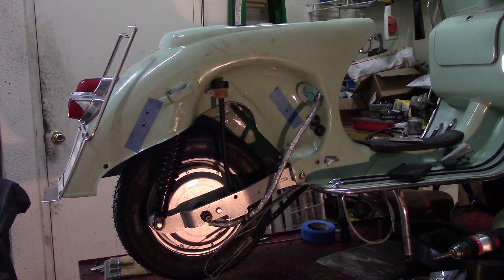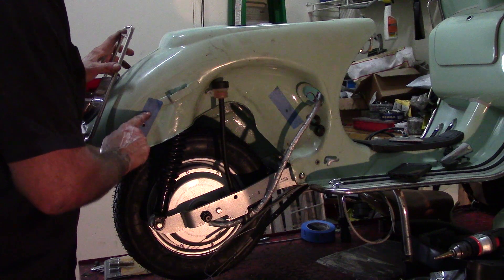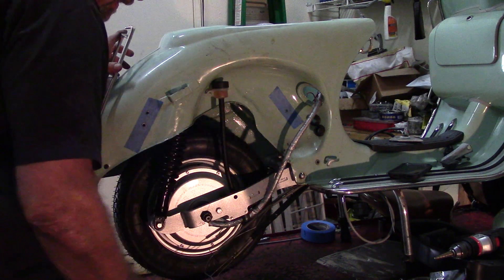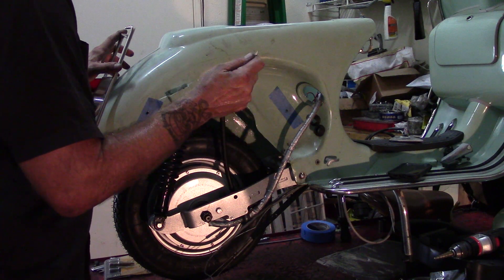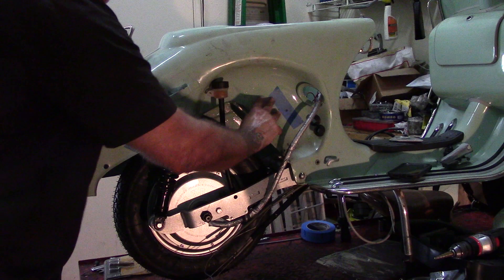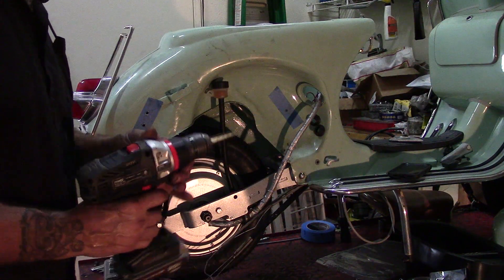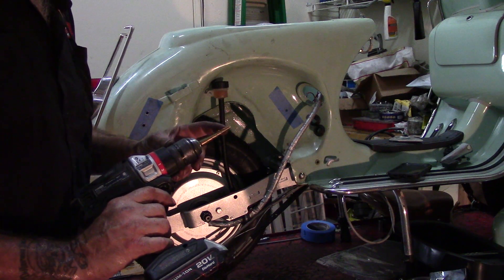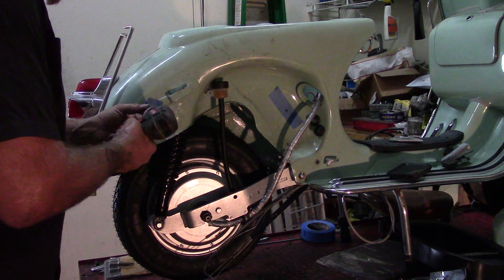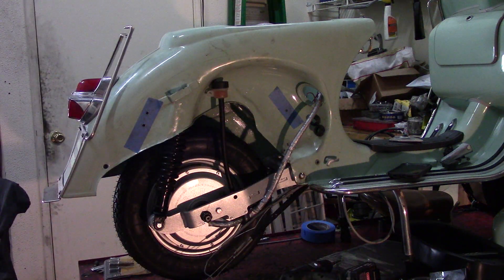It's always good practice when drilling into painted bodywork: you measure, line up the tray, mark where your holes are, take a punch and dimple the metal so the drill bit can bite it, then put a piece of masking tape on to protect everything from scratches. When doing bodywork, I use what's called a step drill bit. It required a six millimeter hole, which is the second step, so you just drill carefully until it's in. Then you're ready to mount the battery box.